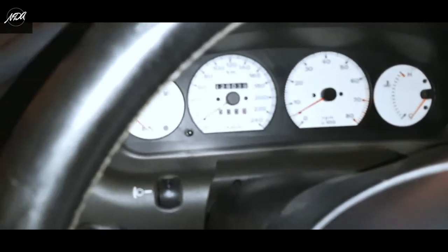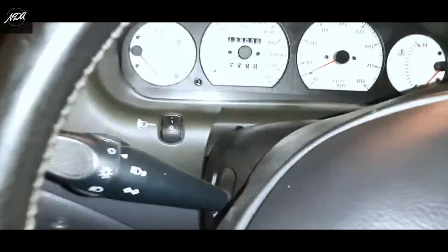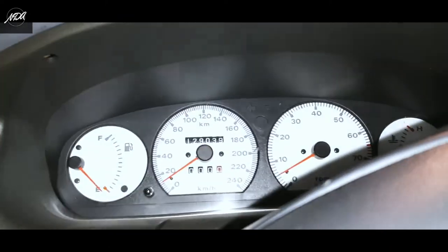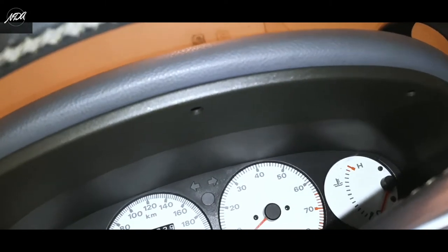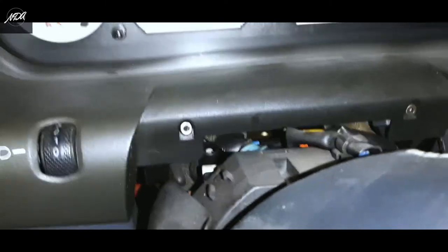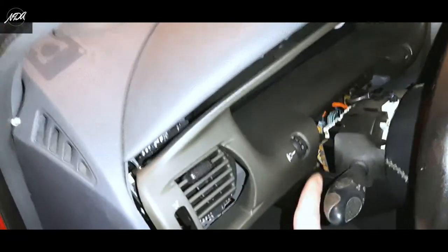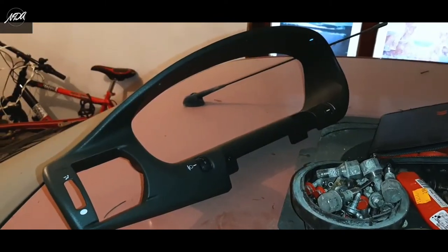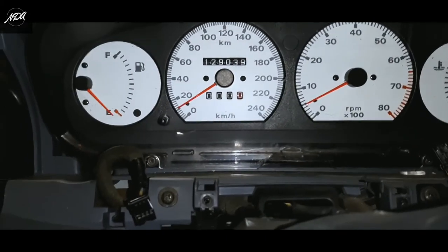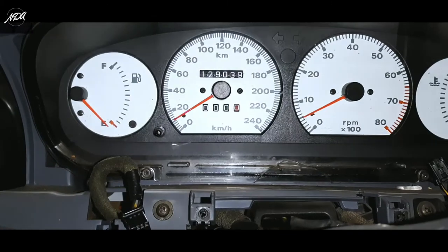Okay, it's day 4 of me trying to part out the Fiat. Today I am going to try to remove the instrument cluster without taking the steering wheel out. I believe to do it I should unscrew 3 Phillips screws on top of the instrument cluster and 2 hexagon bolts on the bottom of it, to remove the plastic panel in front. The panel is ready to go out - I just need to remove 2 clips on each side for these buttons. The plastic panel is out and now the instrument cluster is ready to go. It should be a pretty easy job: 2 hex bolts on the bottom, 2 hex bolts above.